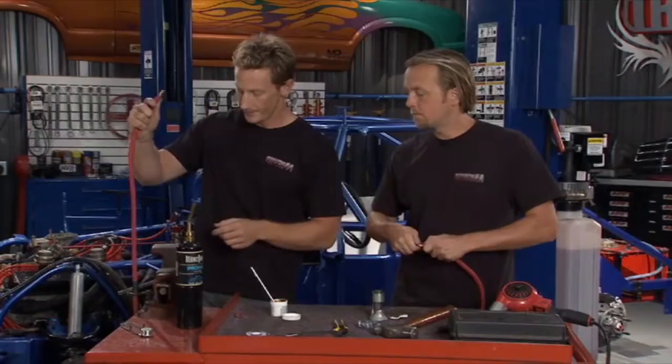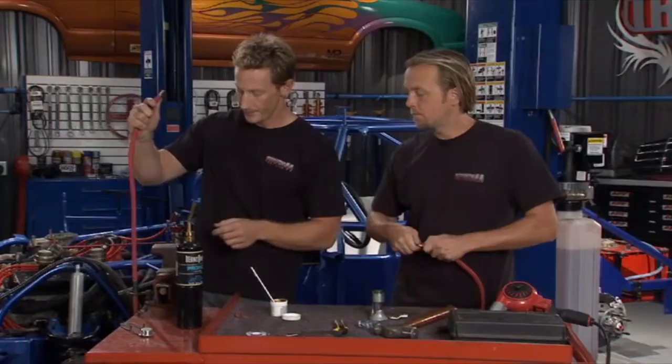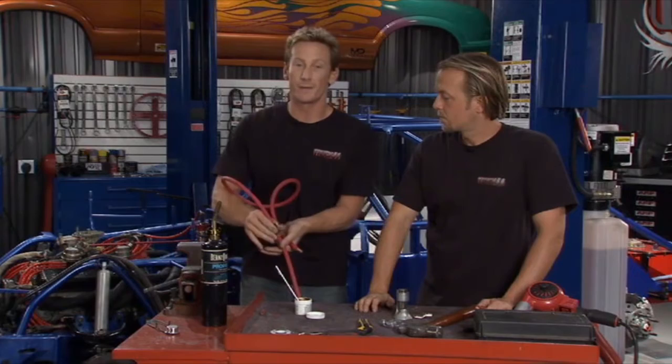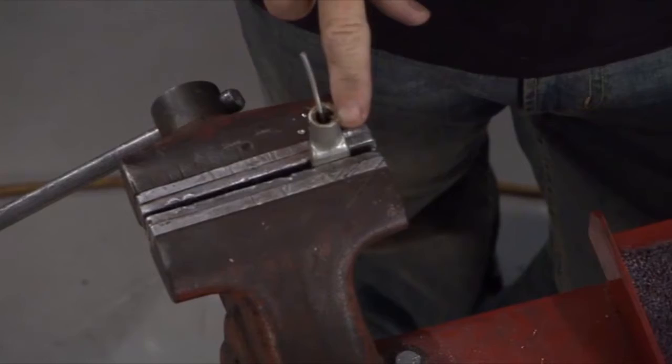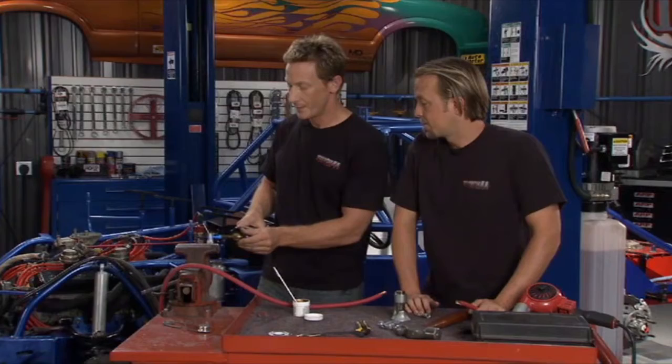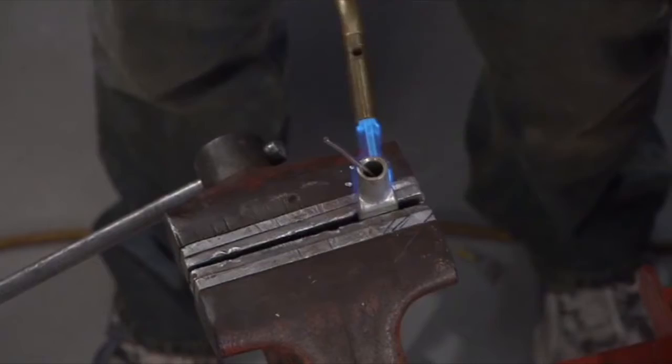Now it's time to make our battery cables. We'll run from the battery in the back of the truck all the way up front to the engine. You could go to your local parts store and have one professionally made up, or you can just do it at home like we're doing. First, you've got your cable and your fitting. We've gone ahead and cut back the insulation so it'll fit down inside. Slide your heat shrink tube back over the tube first — don't forget, because at the end it's too late to put it on. Put a little flux inside so it'll act as a good bonding agent as you solder. What you want to do is heat it up so the lead melts, stick the end inside, let it cool down, put your heat shrink over it — it's just that simple.